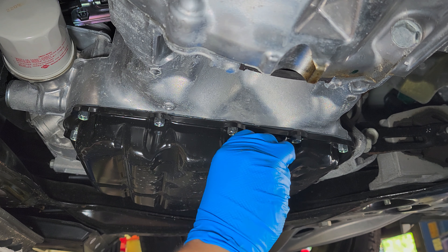I'm going to wipe down where the oil filter sits, then install the new filter. The new oil filter comes with a dry gasket — an O-ring. We're going to lube it with the same oil, just like that. Put it on and snug it by hand. Don't use any tools because you might puncture the oil filter and then you're going to have big problems.